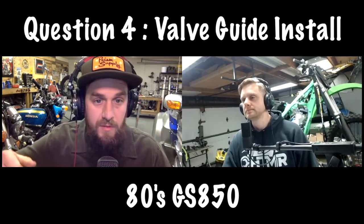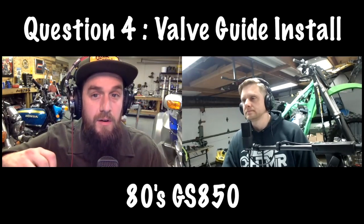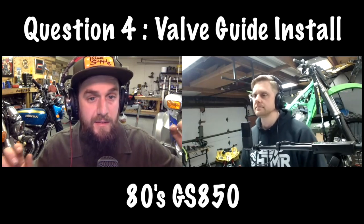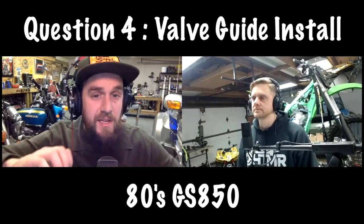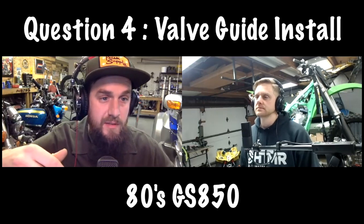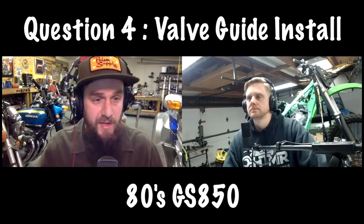The reamer is going to be used to ream the new guide inner diameter. It puts a new surface on the inside of the guide. Now, in a perfect world, what you're going to want to do is exactly what Matt said, make sure that the seat of the valve is now matching the pitch and angle. It's not going to change a crazy amount, but it could change enough to matter, because some material is lost when coming out and some material is gained when going in. But what you can do is install all of your guides, put your valves in, and then check that.